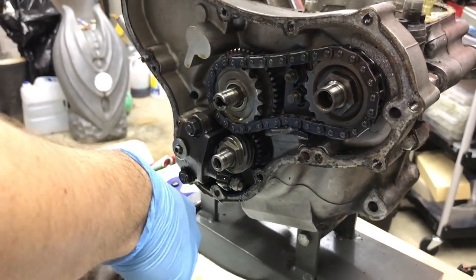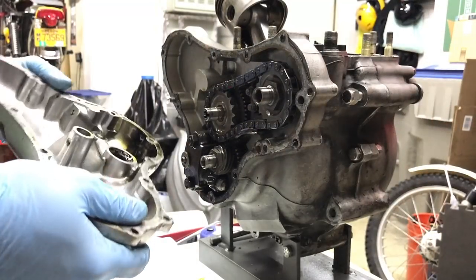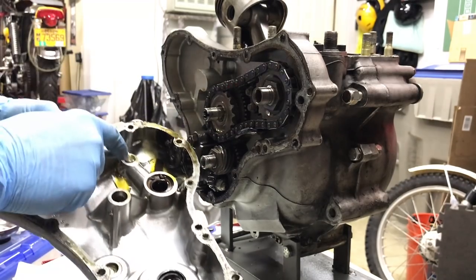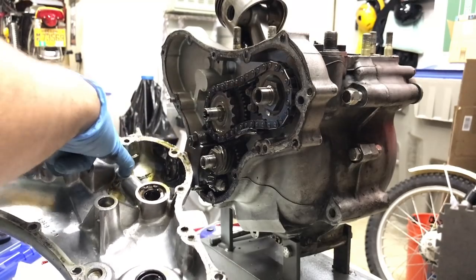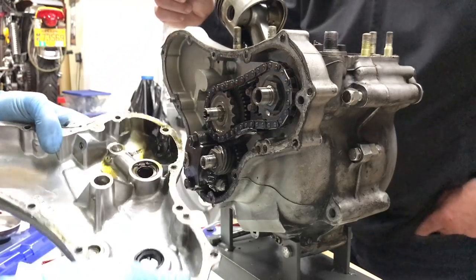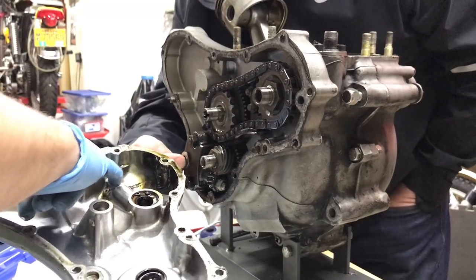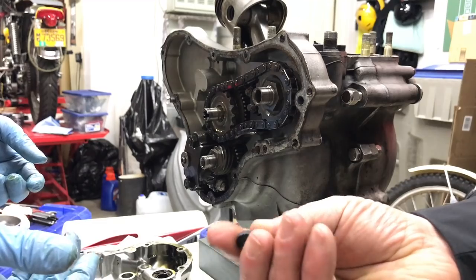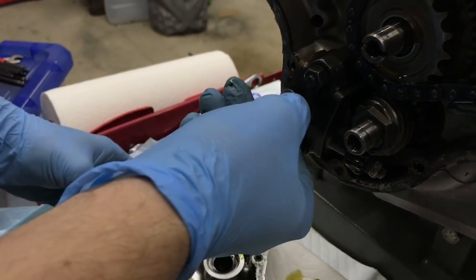I've heard some people like to actually stick that on there, which I can understand. The reason for using a Mark III cover is there's an anti-sump valve in this cover here, and I think that's what we're seeing here — you can see it's pushing oil out. That's where that rubber washer sits against. And you can shim them as well, right? George was saying you can shim these. Well yeah, I've got a washer on there. This is an earlier type — off the Shep Atlas project. The one for the Mark III is actually flat instead of conical like this, to go against this valve here.